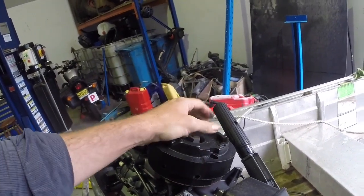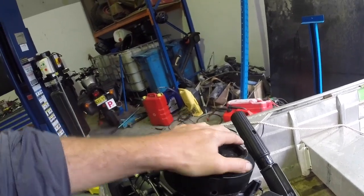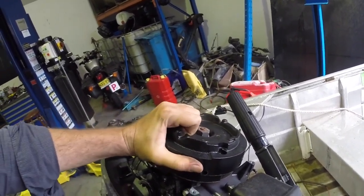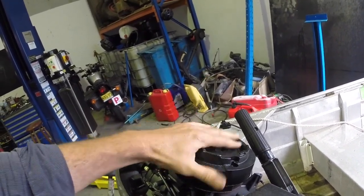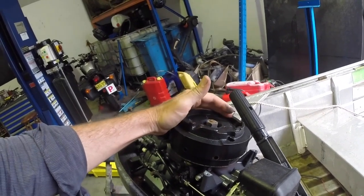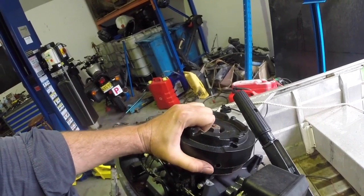Having just put the recoil mechanism down, I've come over and felt this flywheel and it's completely seized. So unfortunately, without even touching that other unit, we know why it's not pull starting - and it's actually not the recoil unit at all, it's this. So I might have to rename this video 'how to unseize a seized motor.'